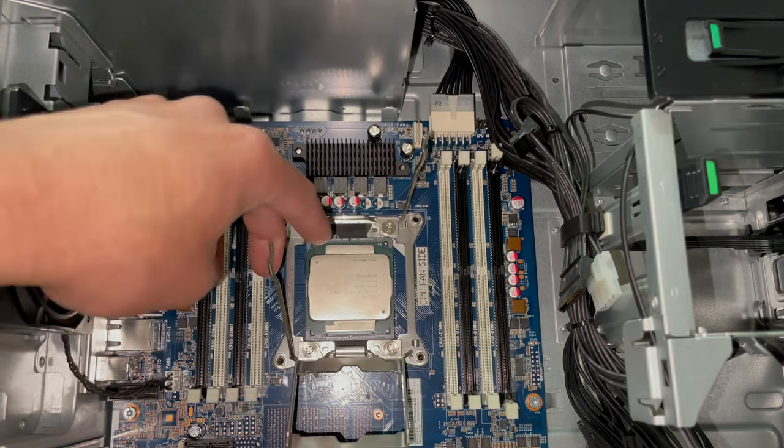All right, so the machine rebooted. This is what I was talking about with POST errors. It'll say the CMOS checksum is invalid. You can fix this with OpenCore, but I just haven't done it yet. So if you want to look into that, that's probably fine, but we'll go ahead and press enter and boot back into our USB drive. Well, we should have an installation, so let's see what we booted into here. Okay, so yeah, we got a POST error because of my memory configuration, but it is what it is.